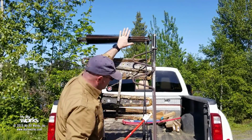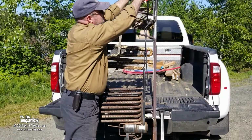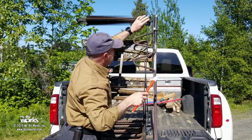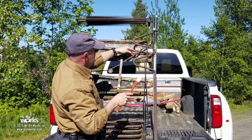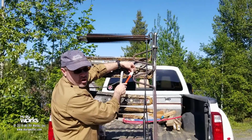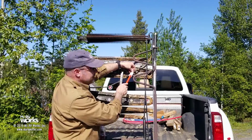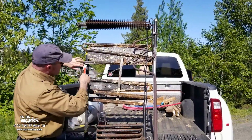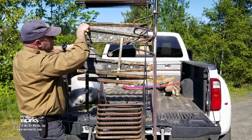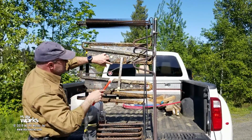Okay, now we're going to stop up here. We have our hydrogen coming up here. Hydrogen and ammonia join in here. They then come through this tube. In this tube, we talked about having an ammonia liquid, strong ammonia liquid, and a hydrogen. Hydrogen is just hydrogen. It's going to come down here. Now, we're going to start working our way back up. We're kind of pre-cooling some of this, the liquid, because it was pretty hot, right?